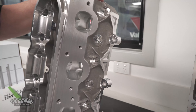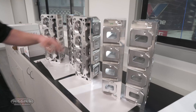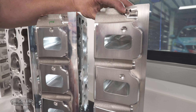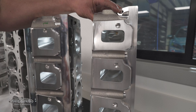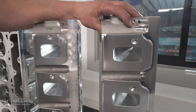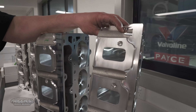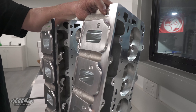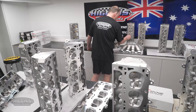All the normal stuff we do here at Higgins Raceheads — pushrod done, they'll take a 7/16 pushrod no worries, guides everything finished, ready to bolt on. This is the LS7. This is the difference between the LS7 ports and the LS3 ports. LS3 come out on all our factory cars in Australia. The LS7 head is a better cylinder head — better line of sight, it's a higher port. But there are a lot of people out there with factory manifolds and billet manifolds already done, so we offer the LS3 so they can bolt straight on without purchasing a new manifold.